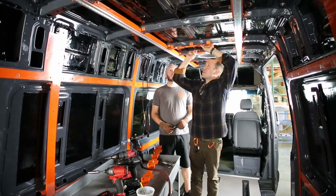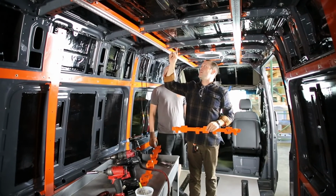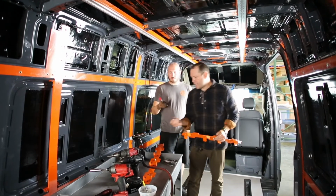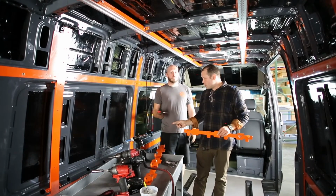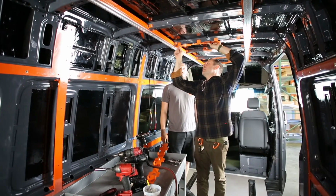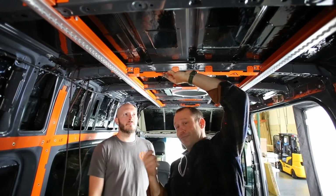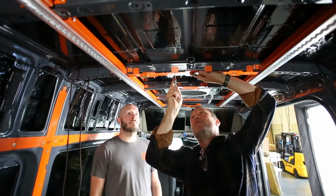Now the key with this is do not just start setting your rivets now, because we need to pilot a hole directly into the center line so that the backside of the PEMs will be able to slip up into it, and this lays flush across this rib. So the way I like to mark that, there's 2 different ways, and if all you have is one of your rivets, it works well. You can also use your set punch that you've been using if you've been using one. So set it up into that middle area, hold it nice and tight and give a little scratch mark there. Hold it nice and tight and put a little scratch mark there. And that's pretty much all you need. You just need to have an index. A simpler way would just be to go ahead and put a couple of pops with your punch.